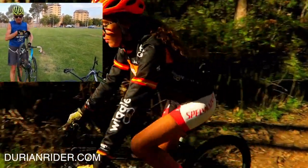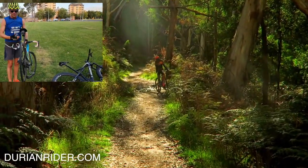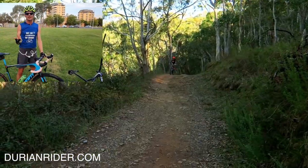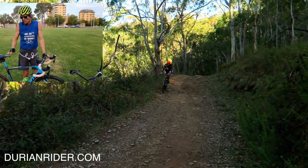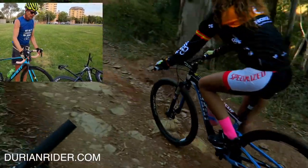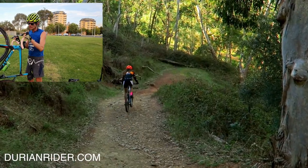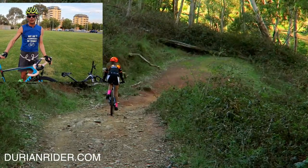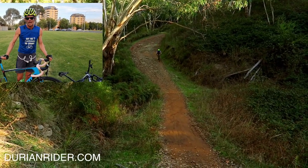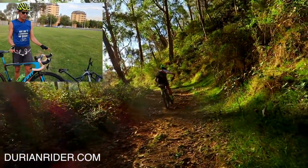The Zipp hub at the back would have broken — about four spokes at the back of that wheel. Wobbly wobbly — the wheels aren't durable. It's got Di2, which is great around town, but if it goes wrong and you're out in the bush, I wouldn't be on a trip at all. It's got hydraulic discs, great around town, but you can see this one here is failing. It's been serviced by a few good shops — I think it's just a warranty claim with Shimano, but because it's past the warranty expiration date, it's going to landfill.